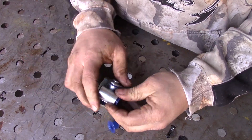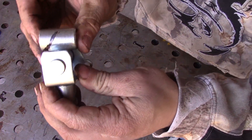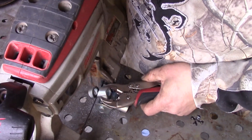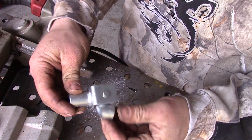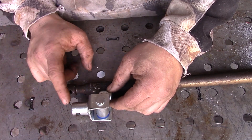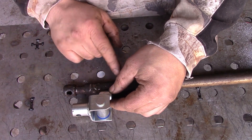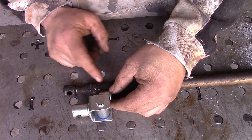Let's pull these bushings out. That's kind of what I'm shooting for — also going to cut off this crap. Here's the line we scribed and I was planning to run it pretty flush with this. But this shaft that goes into this piece, we can actually cut that back, maybe like a quarter inch or half inch. For now we're just going to make another mark onto here, and then the measurement we find out over here we're going to add to this to bring it this way.